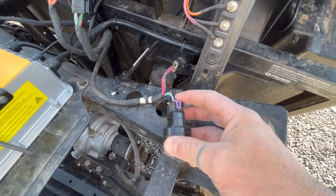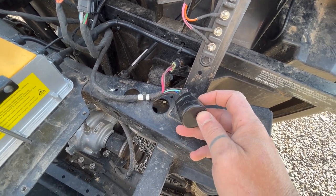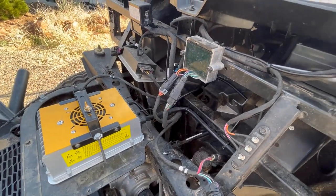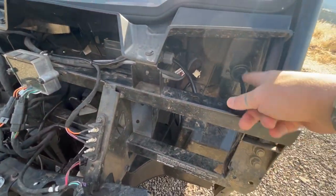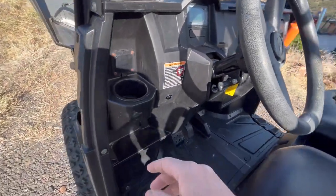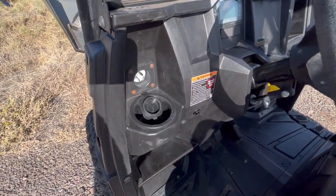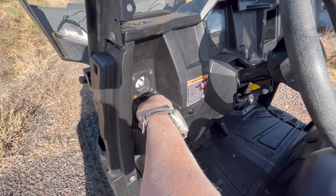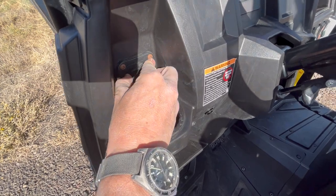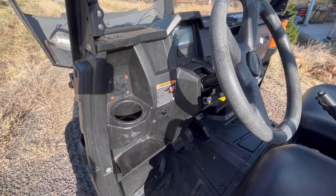I just taped on this cap, and that's got that jumper connection that disables that lockout that I mentioned before. And then you're going to get mains power. There's a lot of places you could put it. I moved it from its original location — I wanted something that was sort of almost in the way, so you're always going to remember to unplug it before you start driving. It's an easy place to remember to plug it in, and when that cable's plugged in, you really can't even get in the car, so you'll always remember to unplug it.